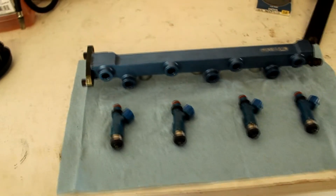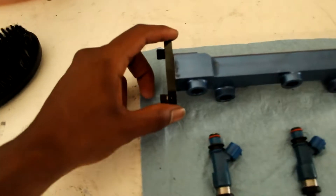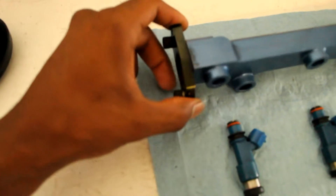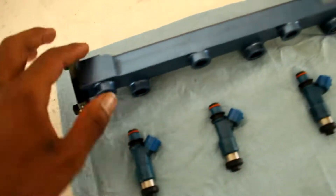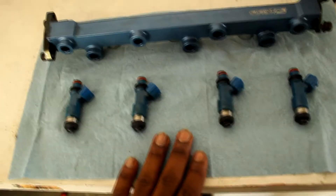In that last clip, my father said the fuel was still leaking. It's because these fittings right here — I can move them with one hand — they're not even on tight. Both of them. So this fuel rail is garbage and I'm getting a new one in the mail, but in the meantime I'm gonna end it here.